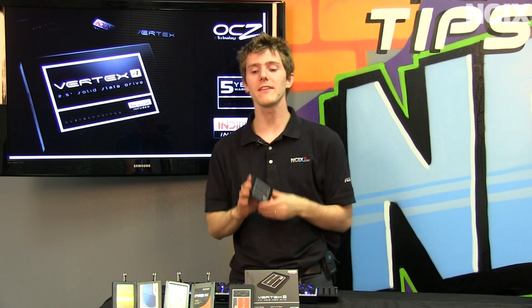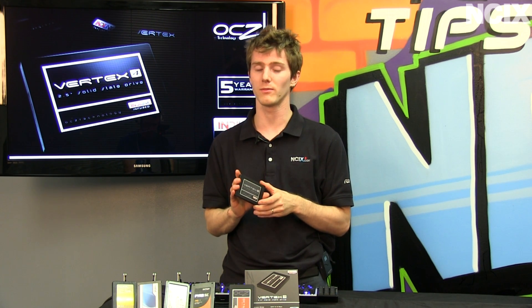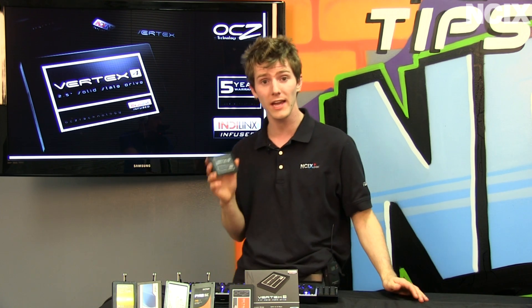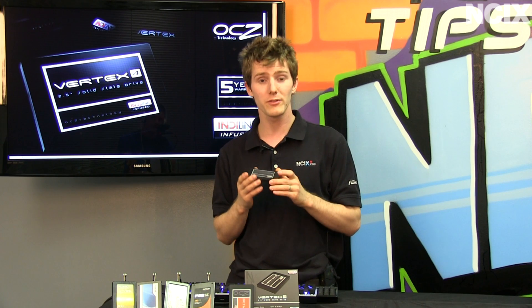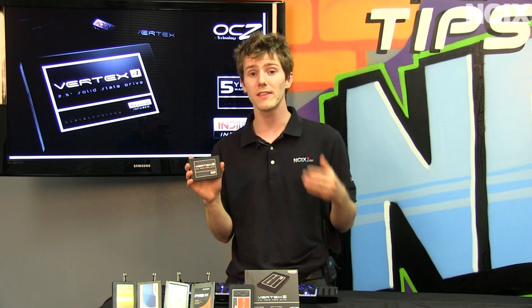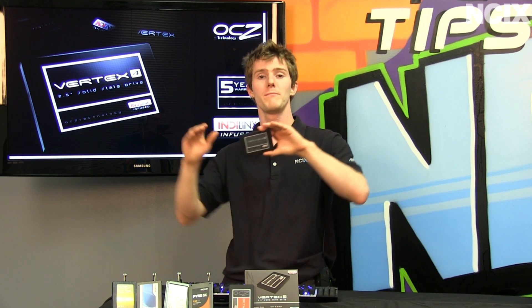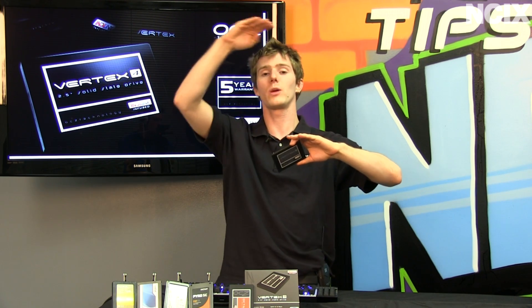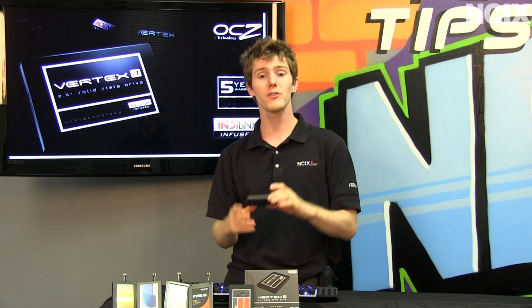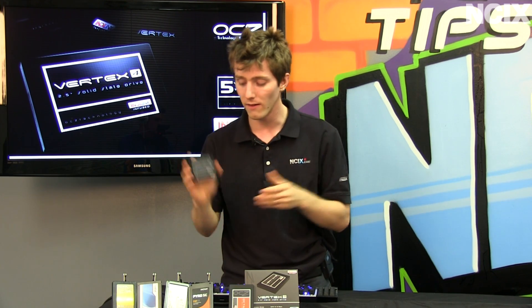A final update for all of you: SSD capacities continue to get less and less expensive. I remember when we first started doing SSD videos — with the Corsair S series, I think the first SSD video I ever worked on. A lot of viewers said they wouldn't touch an SSD until it got down to the dollar-per-gig range. Well, of all the SSDs in front of me, there are Vertex 3 drives that, after MIR, are down to under a dollar per gig, and Crucial M4 drives that are around a dollar per gig. The Intel 520 series is still quite expensive, whereas the Vertex 4 strikes a balance between those lower-tier SandForce drives and Intel's premium positioning — performing nearly as well as the 520, with the five-year warranty, and falling in between in terms of price.